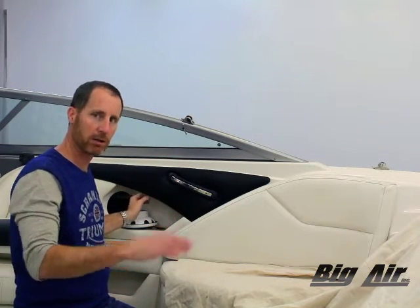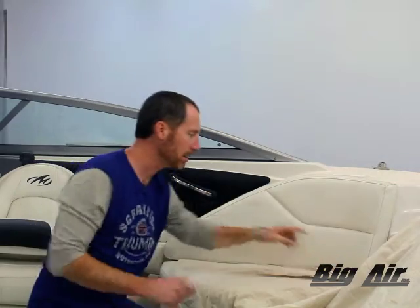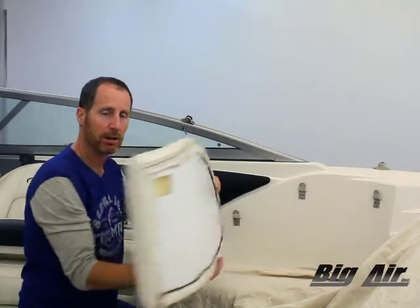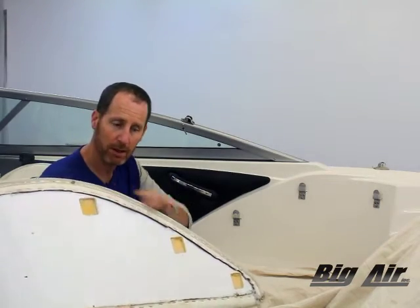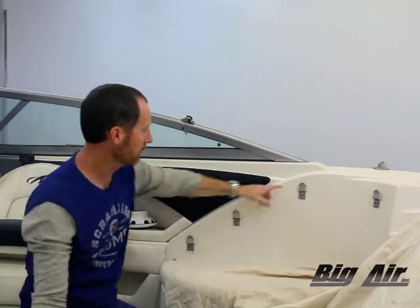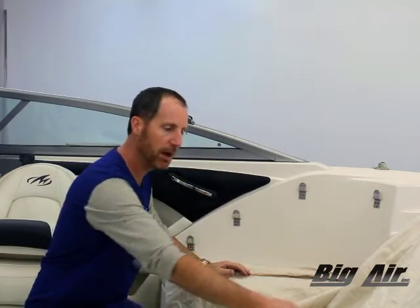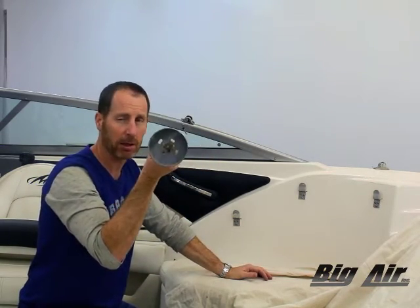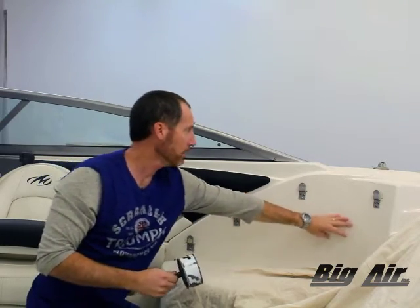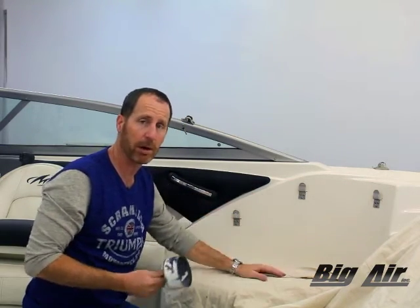Planning in advance — that's where you always measure and make a plan of attack on a tower installation. This interior panel: it's really quite simple. I've gone in and removed two screws located here and here. Now I'm going to lift it off using J-hooks. You can see some holes that were cut there, and the screw tabs I took out — just Phillips head screws. The panel hangs on latches and that's where the screws went. You can go to Lowe's, Home Depot, or Ace and get a four-inch hole saw to get your hand through. I'll cut a hole, find the right position to access my mount, and once we put the panel back over, problem solved.